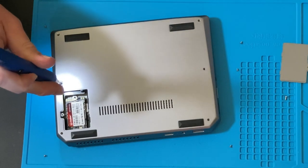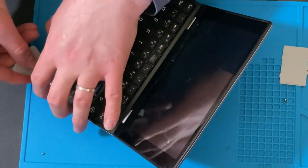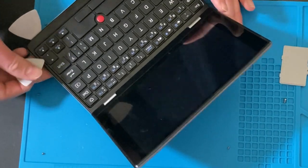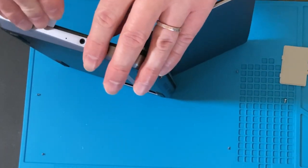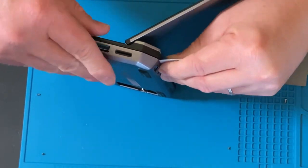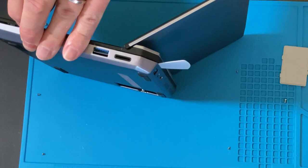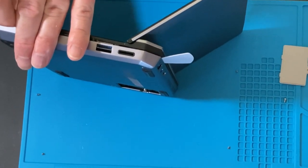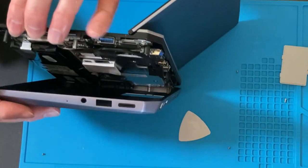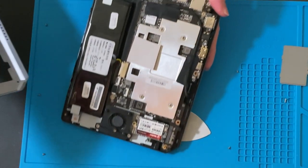I've got to figure out how we're going to open it. I'm going to try and use these guitar pick prying tools. If the bottom is all metal it probably pops out through the keyboard side. They seem to be getting somewhere, so we're going to try a couple more to separate it. You can see there are some plastic clips that run along the edge - we just have to pop those out. Attach the keyboard frame and once it releases we're just going to flop it over.